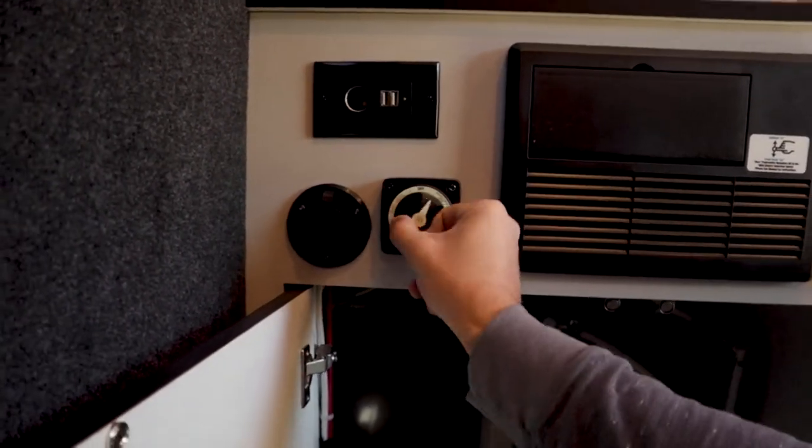I also have a battery monitor — this one is from Go Power — so I can monitor the battery state. Let's get started. I'm going to begin by turning the battery disconnect to the off position, which completely disconnects the battery from the trailer. Since this is a video, I'm also going to disconnect shore power from the trailer — one extra step of safety that's worthwhile. Do as I say and as I do this time.